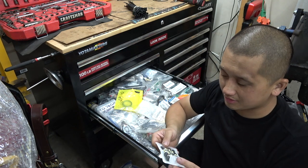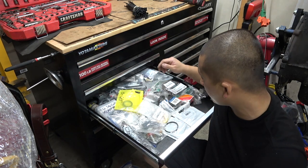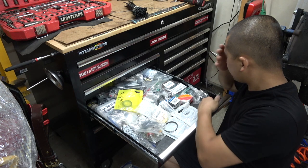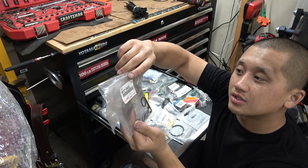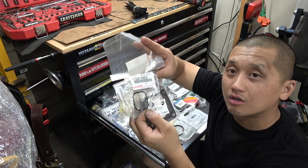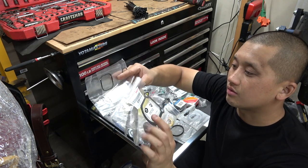These are LED lights from Amazon that fit into your side marker — highly recommend replacing them, they look super bright and awesome. This is an oil pan bolt and a banjo bolt for a fuel line or fuel rail — good to have just in case. There's an O-ring — 9672124022 — this is for the back of the timing cover on the 80 series. You also have a rectangular one that goes on the bottom. These are super important — people always forget about these and end up using RTV, and then it leaks back. The rectangular one is part number 1132866020.